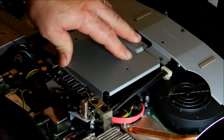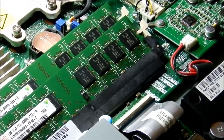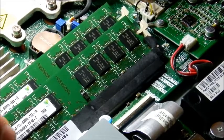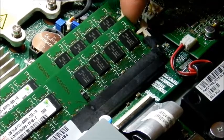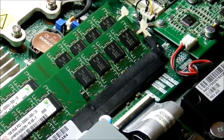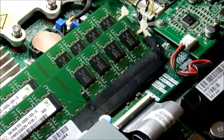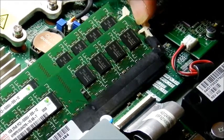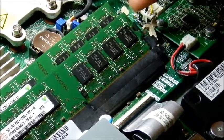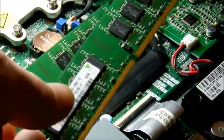Unlike my touch screen HP all-in-one, this has big chips — it uses the same desktop memory. The memory chips are large, the same as what goes into a desktop computer. You want to be careful about electrostatic discharge when you're working inside this thing. Pull these two tabs out — you see how it pushes the chip out — and lift it up.